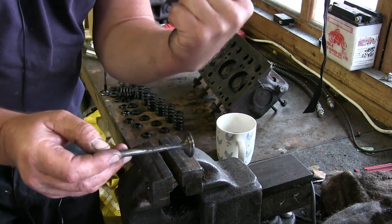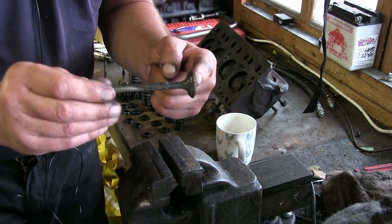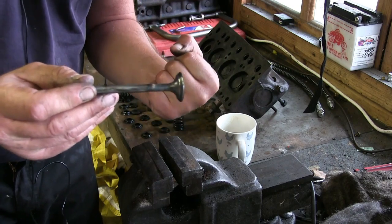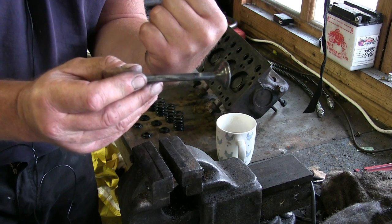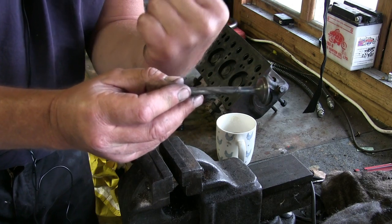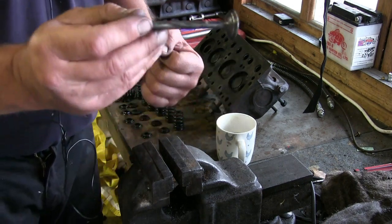And what happens then is the piston then gets forced down the bore, which is your power stroke. And when it comes back up again, this is an exhaust valve. So what happens is when the compression comes back up again, it pushes open the exhaust valve just before top dead center and starts to push the exhaust gas out. Okay, I said that wrong actually.